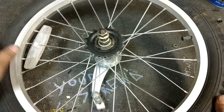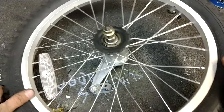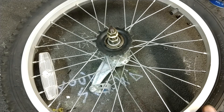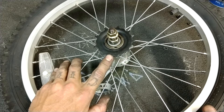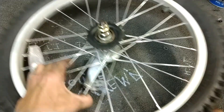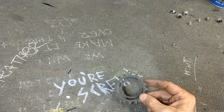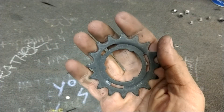The only real difference is that some of them will be completely flat and some of them will be offset up, like you can see on that one. So what is Pepper's Mod? Pepper's Mod is a little bit of tomfoolery that is tried and true, and I have tested it on thousands of miles. What you can do is find yourself a three-speed or multi-speed internally geared hub or coaster brake cog, one of the three-tab ones. You need to make sure it's a 16-tooth, like this one here. It's just a normal stamped steel 16-tooth cog.